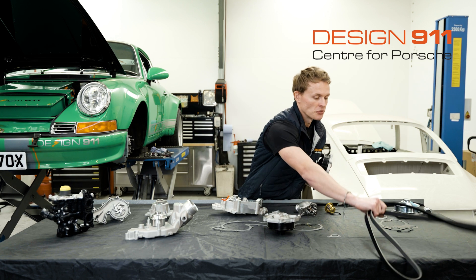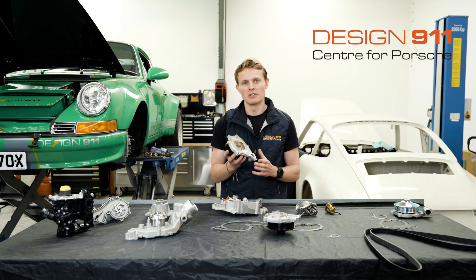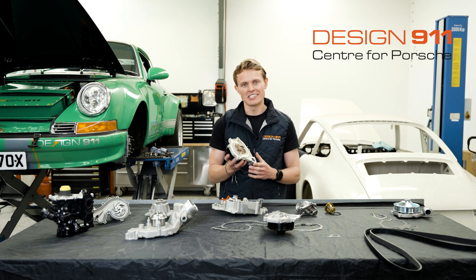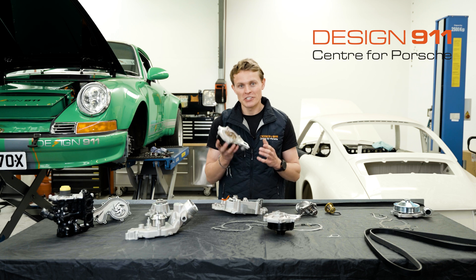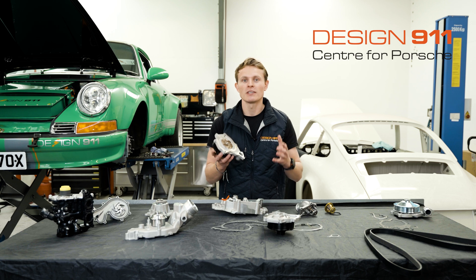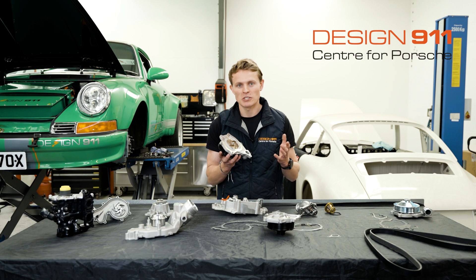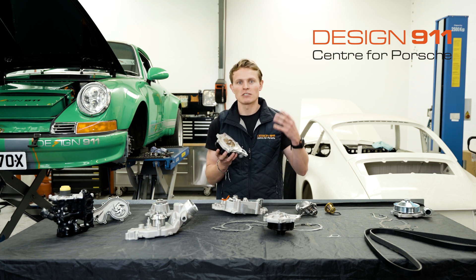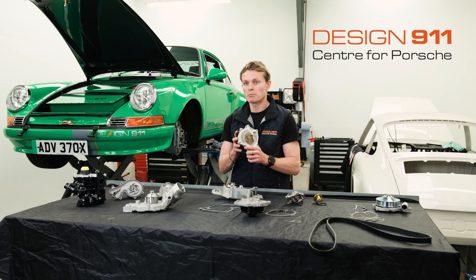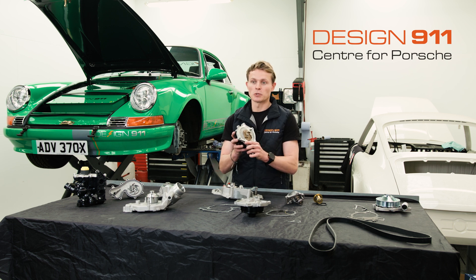When an engine is running at idle, a water pump moves approximately 10,000 litres of water an hour. When the engine is running at high speed, this ramps up to 35,000 litres of water per hour. You can imagine what happens when this thing goes wrong — all of that water stops flowing, and since that water is there to remove heat from the engine, the temperature rises and rises until your engine goes bang. So if your water pump fails, it's really important to stop your car as soon as possible and get your water pump changed.